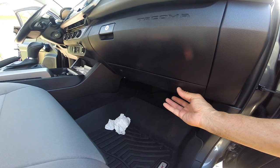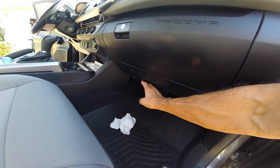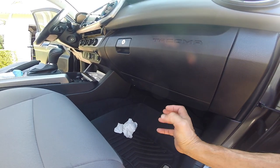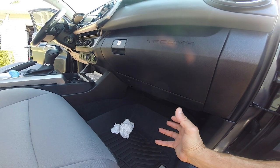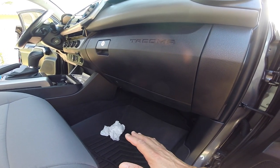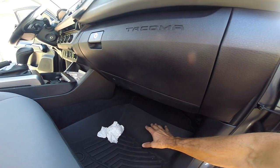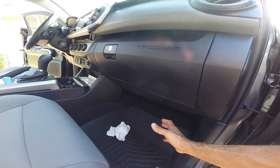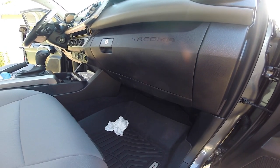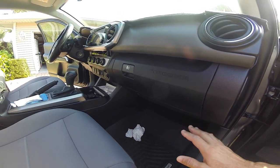Then you can go ahead and remove this. I'm understanding that once you drop this out, there will be enough wire for the airbag to drop. There is a manual that shows where you can disconnect it and pull the airbag off to the side, but I'm going to try not to do that. I'm basically just going to have it drop enough, because there's no reason for me to take out the airbag — just move it out of the way so I can get to this console. Just be aware that once you start working on this, you need to have no power whatsoever running on this system.